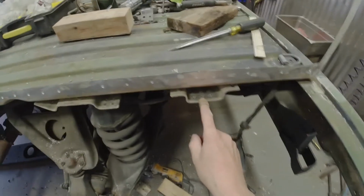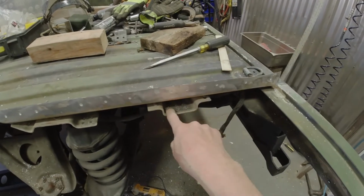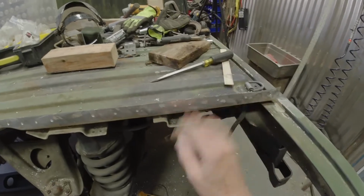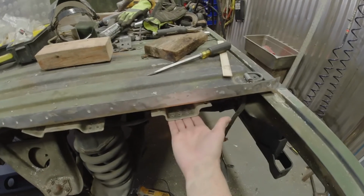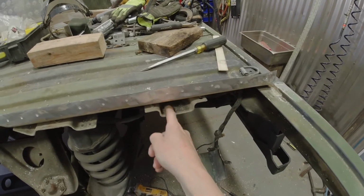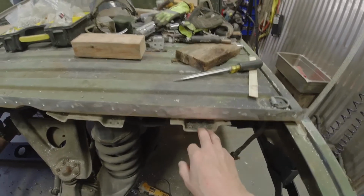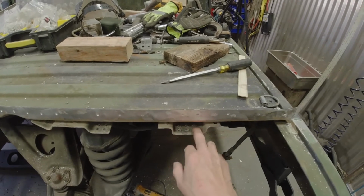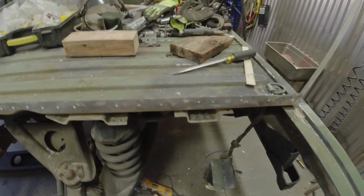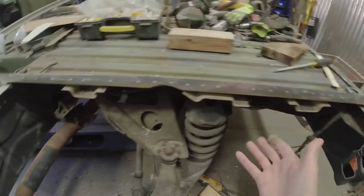On these rivets, the fender sits under here, so you can't drill the existing holes unless you take this panel off, take these rivets out, bend it back or something, but that's a pain in the butt. Just figure out where you can move the rivets over so they end up in between here. You see what I'm talking about? And then if it bothers you that you can't line up the exact rivets to the holes, I would suggest a new hobby. Something like rocket science or brain surgery, something where it matters.